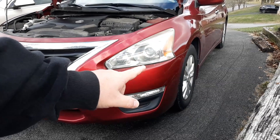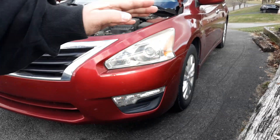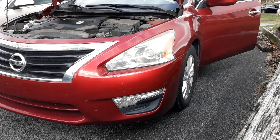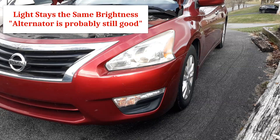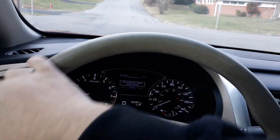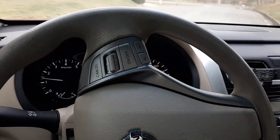I'm going to turn on the lights and rev up the engine. If the headlights start getting brighter than they already are, that might indicate a problem with the alternator. If the light stays the same regardless of whether I'm revving or not, then it most likely means the battery was the issue. After doing the dim light test, it's a pretty good indicator that it's not the alternator.